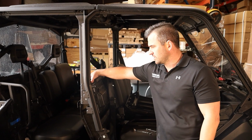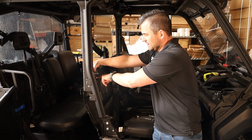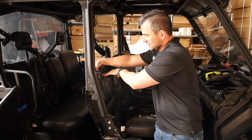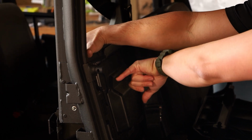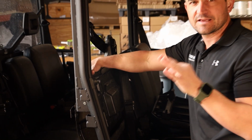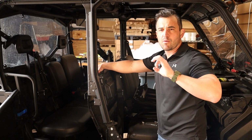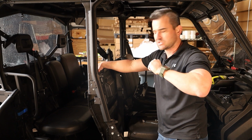We've taken our 6x25mm bolt. We've drilled our hole here 7-8mm so that we've got a bit of tolerance there when we put our 6mm bolt through. We've reused the OE bolt that's come out here, but we've included one of our thick 6mm washers just to give it a little bit more pressure on where the actual bolt goes in and actually holds that tight.